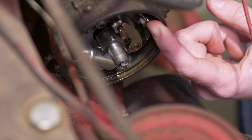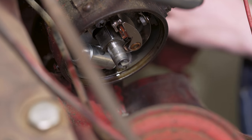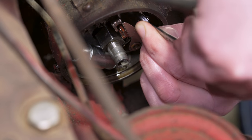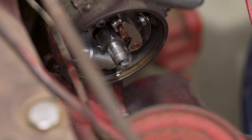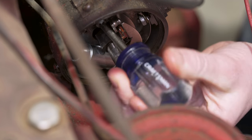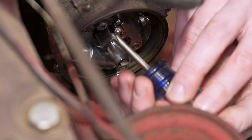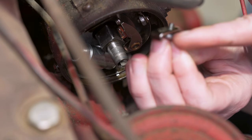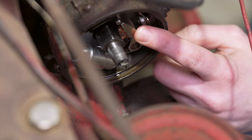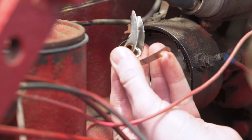The points are held in place by both a nut on this side and a screw up there on the top. You can use a very small wrench — this is an 11/32nd size — and get on that nut and just loosen it up. Don't take it off all the way, but loosen it just a little bit so you can pull that tab off. For the screw, just use a regular screwdriver to pull that screw out all the way. The points are two pieces, so you're going to get this little tab here first. Notice that there is a tiny little lock washer behind there. The second part of your points you can grab right onto that tab with needle nose pliers and pull them straight up and out — that will be the removal of your points.